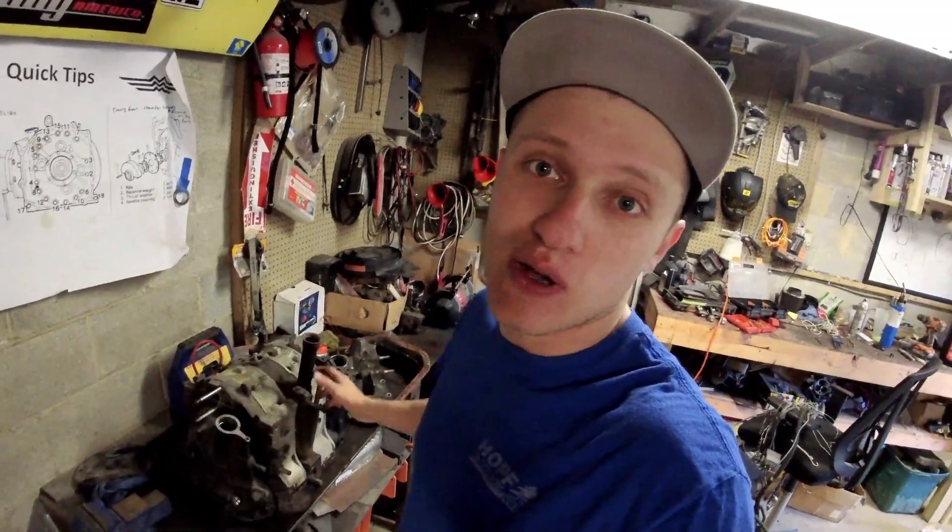What is a mock-up engine? Why would you need it? Why would you use it? A mock-up engine has no guts — it's super light. It's what you can stick into a car to figure out engine mounts, figure out general plumbing procedures, figure out where your transmission mount goes, locate the engine — the whole deal.